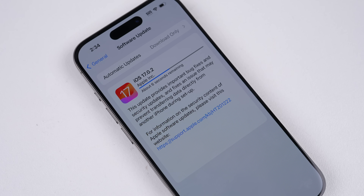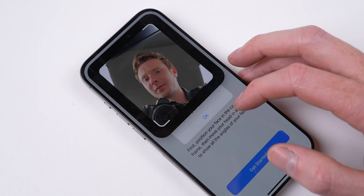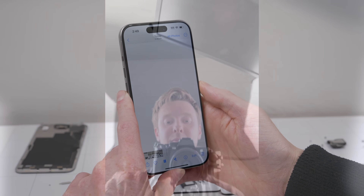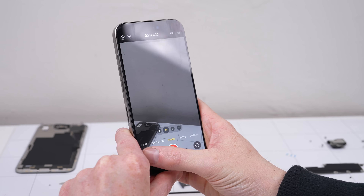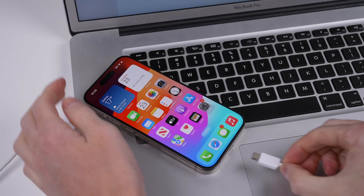There is a partial fix for the front camera: it requires updating over the air, or performing an update or full restore in iTunes. The need to flash the software on something like a Face ID sensor replacement sounds like a genuine security feature. However, while the camera now gets an image, something still prevents Face ID from working or the camera from capturing the image properly. Trying to take a photo freezes the app, and taking a video results in a blank file that only captured the audio. Somehow I forced it to take one image — it looks as though it's the raw output from the camera, without any post-processing. Will Apple fix this? I'd like to see them fix it, but I have low hopes given all the other issues that still remain. Swapping the logic boards back to their original phones, everything suddenly starts working again, except the front cameras which require a flash to function.